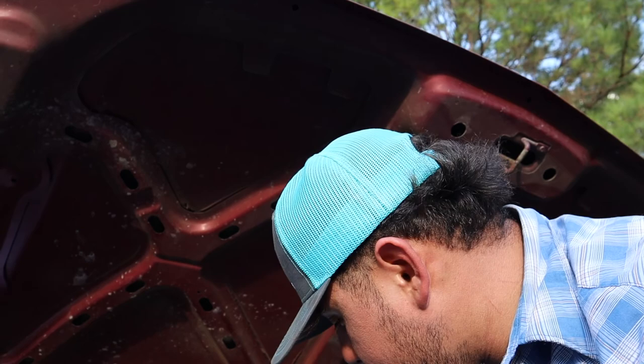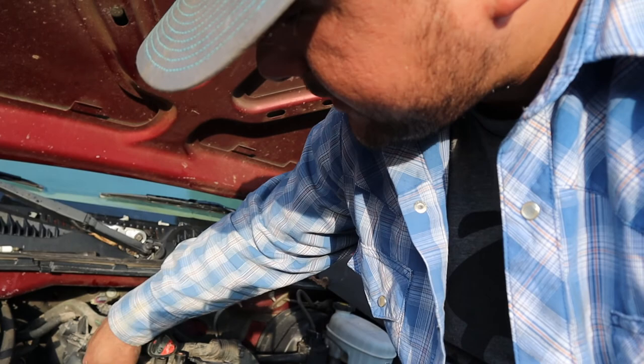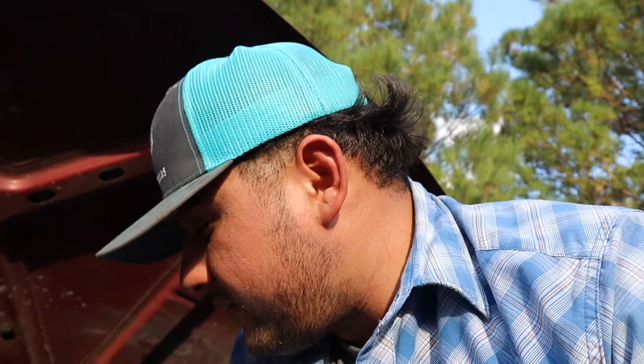At the beginning, I did mess up a couple of them because I would just drain the spark plugs and wouldn't drain the intake. I would turn the engine with a ratchet and it would turn loose, but the intake was still full of water, because there are low spots where the water won't come out. So the engine would spin freely with the ratchet. But once it cranks and starts spinning real fast, the water that's stuck in here goes into the pistons again through the valves, and it'll bend the valve, or you can even bend the rod.